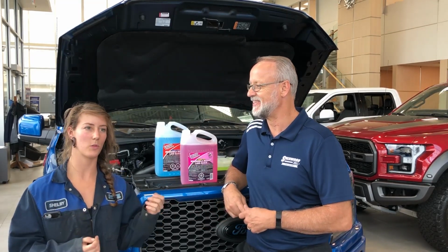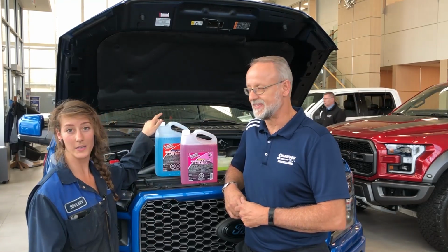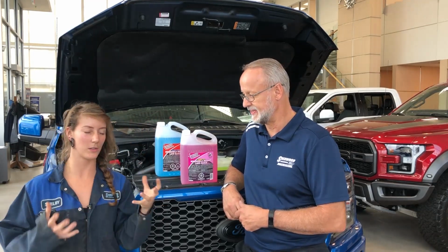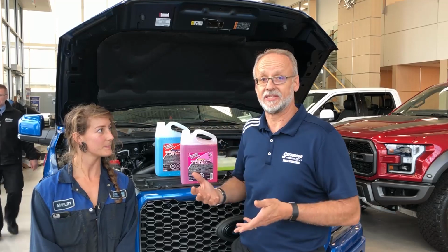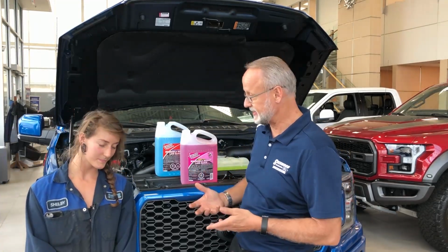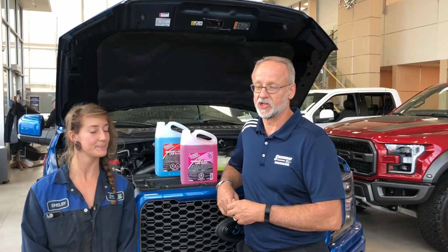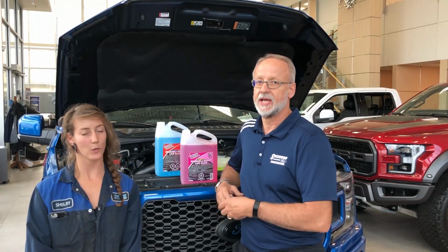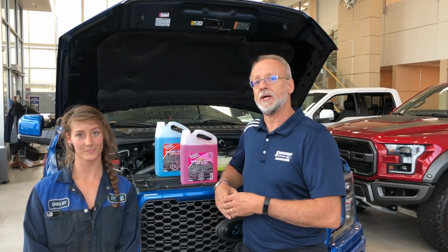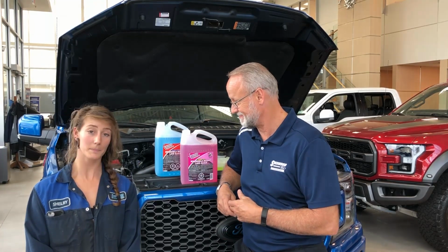We would recommend, transitioning from summer to winter, going for more of a winterized or antifreeze agent, which also includes your methanol and ethanol agents in it. Those things that are added to the windshield washer fluid keep it from freezing up and gelling and causing your pump to wear out. Man, that's the last thing you're going to want to have happen, is that washer fluid freeze up on you. So guys, if you're uncertain, bring it down to the dealership and get it checked. Yeah, have it checked out.